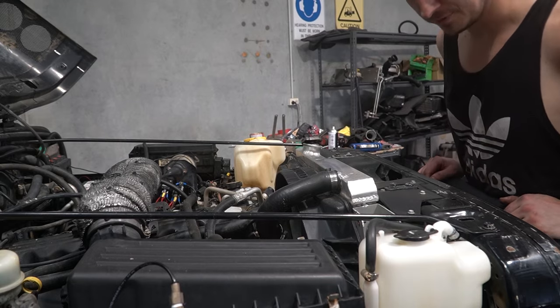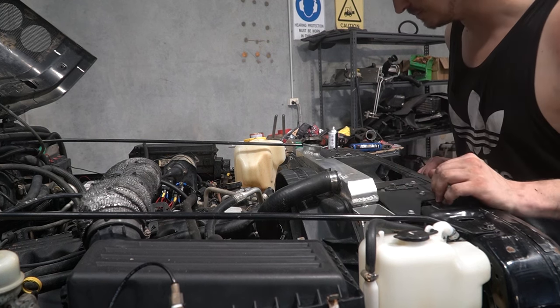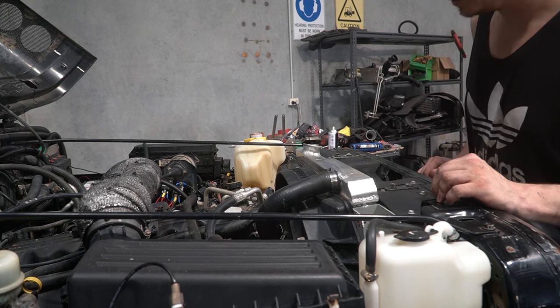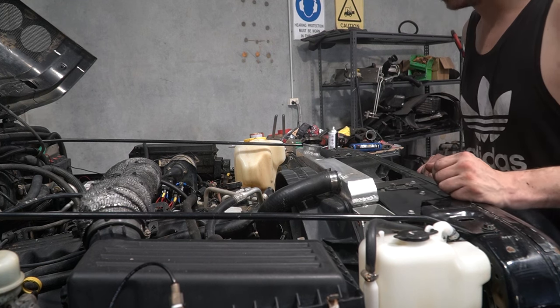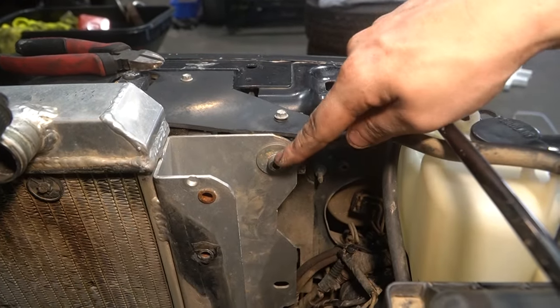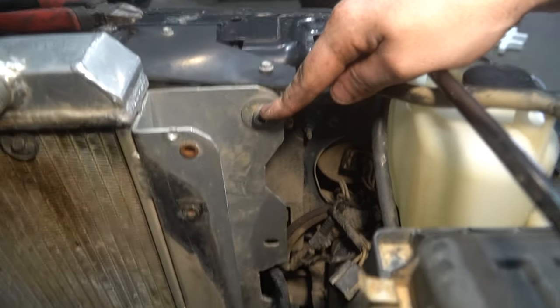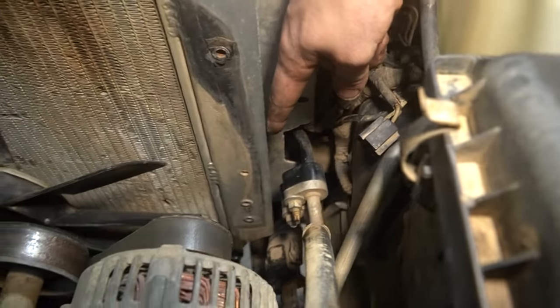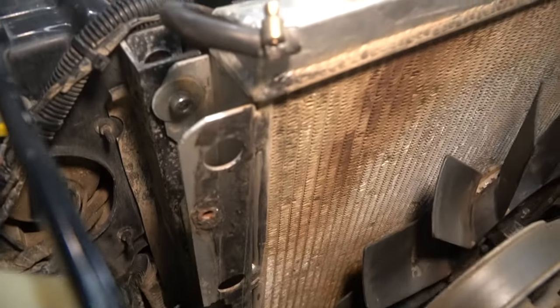Now this is hopefully going to be very straightforward. The radiator shroud is held on by zip ties, thanks previous owner. Then there's about two bolts, two hoses, and then it should come out. Now it wouldn't be a modification if it didn't have evidence of expert mechanics in the works. So you've got one cap head bolt here. Down there, there's some kind of random 13 mil headed bolt there. And on this side, it's pretty much the same. At least they were consistent.